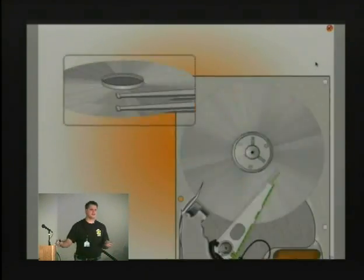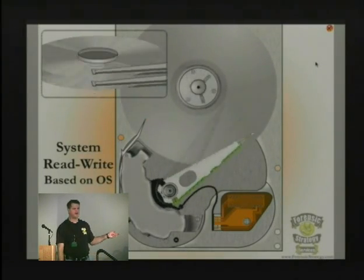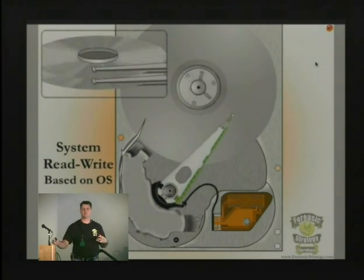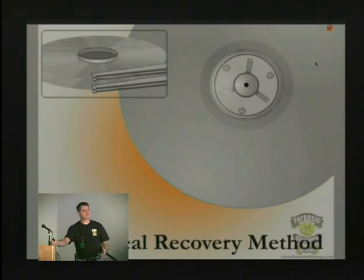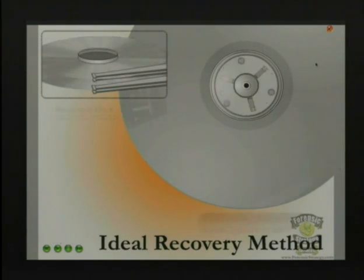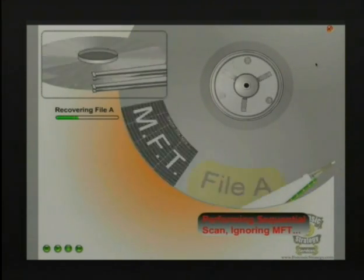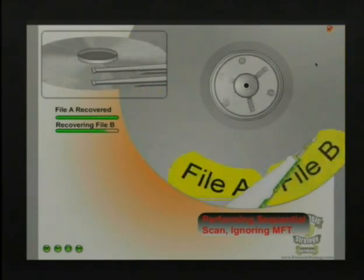This is the basics of how the operating system reads and writes files. If you're trying to do a data recovery, this is pretty violent. If you've got something wrong with the drive — it's scratched or whatever — and the head is moving over that platter that fast, there's a really good chance you're going to hit a bad spot, actually damage the head, and you won't be able to read that data at all. The ideal method is to do a bit stream type image, where you read the data from one end of the platter to the other as smoothly as possible.